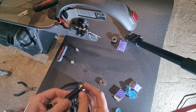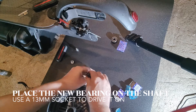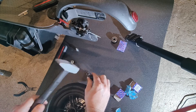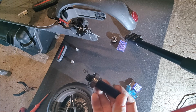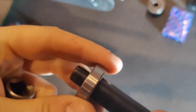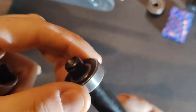So this is going on like that, and the socket goes over there. We want to hammer on the inner race, not on the outer one — until it seats down like that. We want to hammer on the inner race, not on the outer one, then we can drop that in.